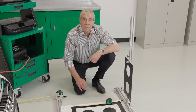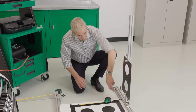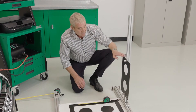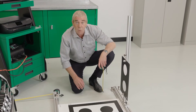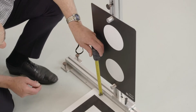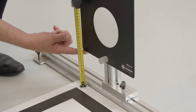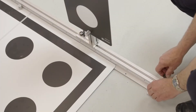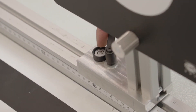The last step in positioning the targets is to fit the rear cam one additions, set them at 77.5 centimeters on the measuring scale, and then we fit and adjust the target CSC 3-01 to a height of 13 centimeters from the bottom of the target to the base of the CSC 2-01 reference panel. Finally, we make any adjustments required to ensure the spirit level bubble is centered.